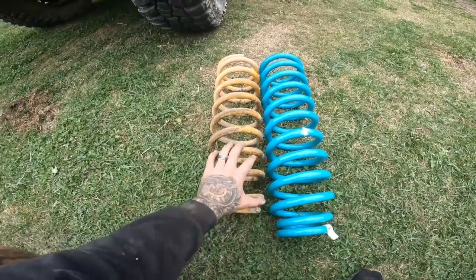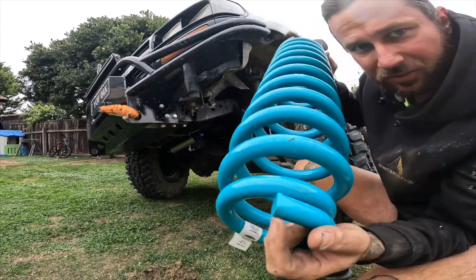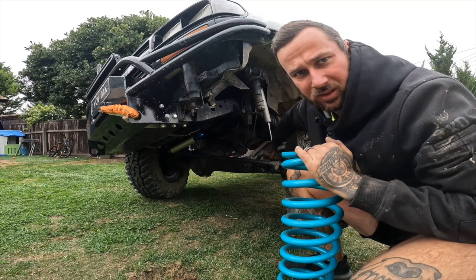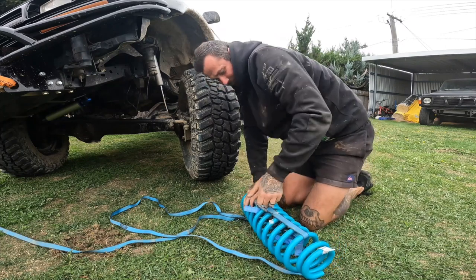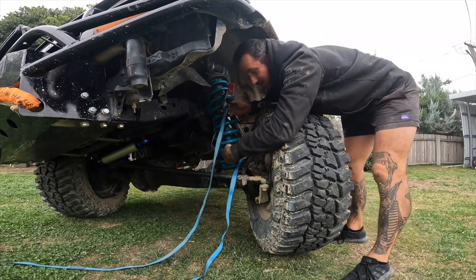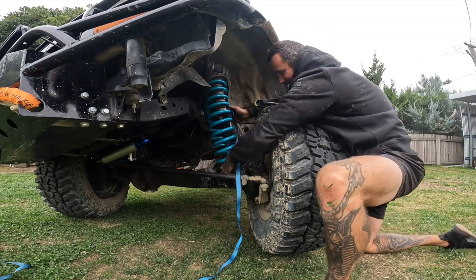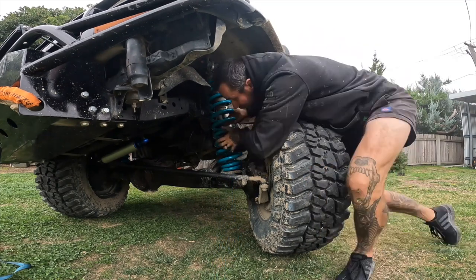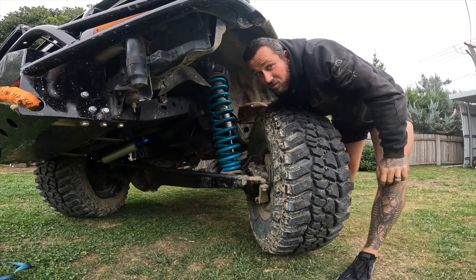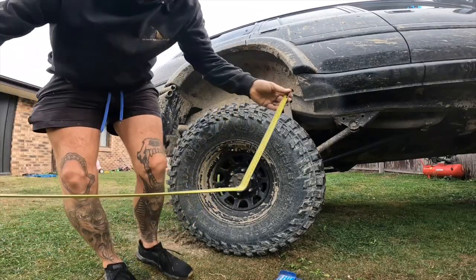So yeah, that'd be pretty close to your 50mm, which should be another two inches. To help get them in, I've just loosened the back bolt on my radius arm. On the passenger side it's got a little divot on the front; driver's side the divot's on the other side. If you're wondering why I'm using a hammer, I've jammed my hands in them a few too many times and it's not fun, especially in tight little awkward spots. So that pretty much is a four-inch coil just unseated — about a metre, metre five. I'll go check the other side. This is just with the sway bar disconnected.